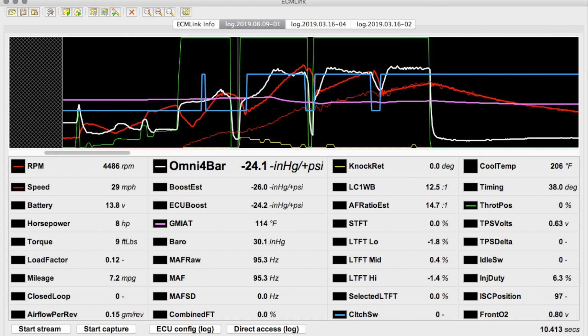I can't do anything about that second gear knock because second gear hits the exact same airflow cells as third and fourth, and those are exactly where I need them to be right now. I thought this exhaust would lean me out some, and it did in one little spot where the turbo was spooling. I didn't change anything going into my next run though because this run was so bad. Running rich is exactly a good sign of what's to come. Let's do that again.